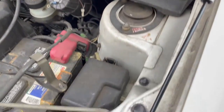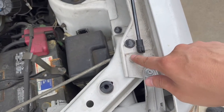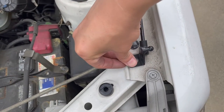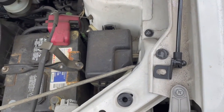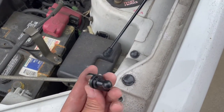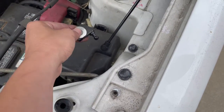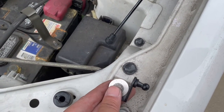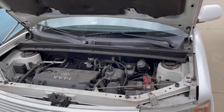Down here you're gonna take this bolt off — the first bolt you see for the fender — and you're gonna use this bracket right here like this. I used the washer right on top. I got the ball joint with the screw and the washer right here, but before tightening it down I'm gonna push it into the shock first. Reason being is because once I have it in place I won't have clearance to push this in.